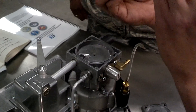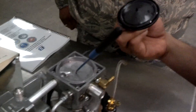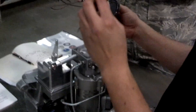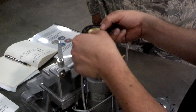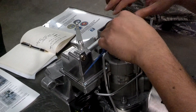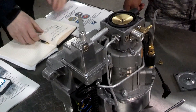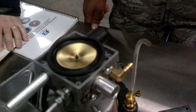If this tip is ever stuck in that hole, fuel can't get in there. And what causes that is that this golden disc sometimes falls out of its seat. So if you ever take a pump apart and you see this, that could stop you from sucking fuel or putting fuel into the system.